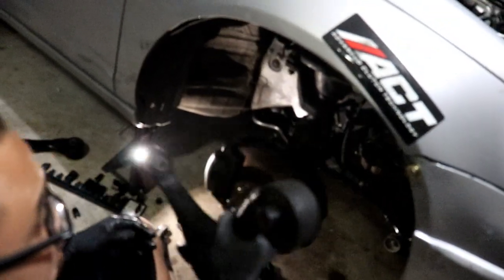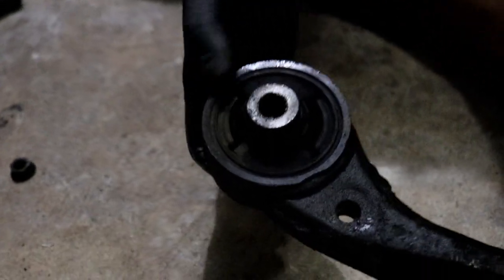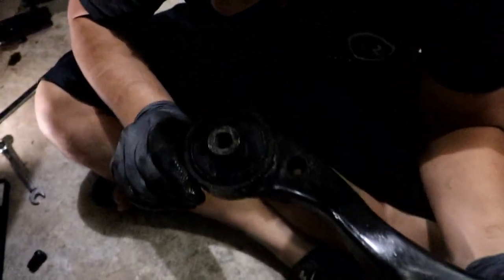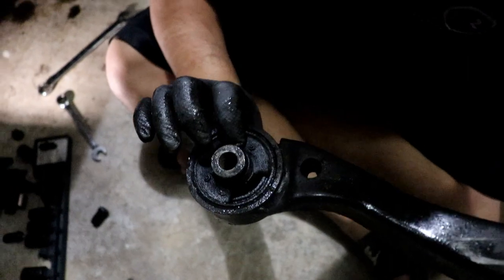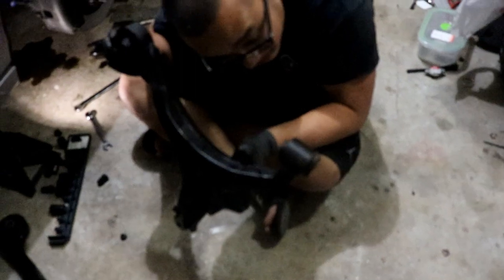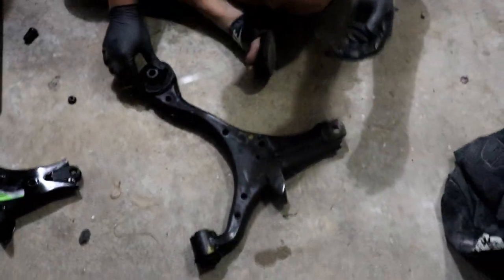Steve just let me know that one of the sides was loose, but the other side you needed like a pry bar or something to get it out — it wasn't too hard. It looks like the bushing in this one is shot. You can see it's formed a crack, actually cracked all the way through. I knew these were bad when I was driving — you could hear sounds coming from the control arms when you make turns.